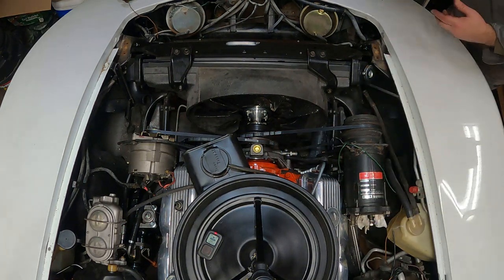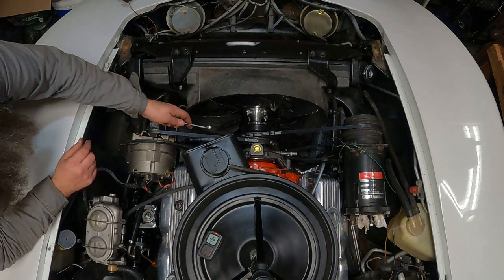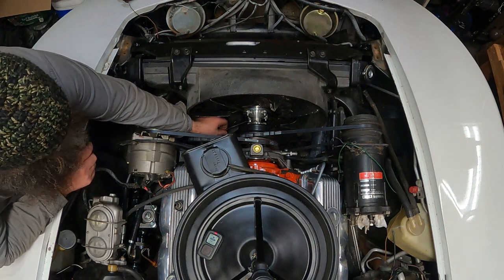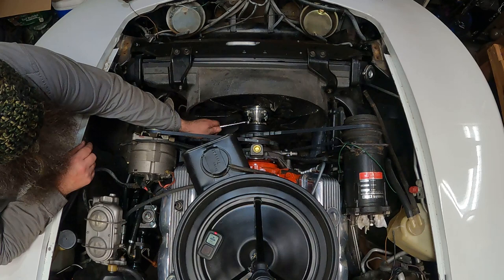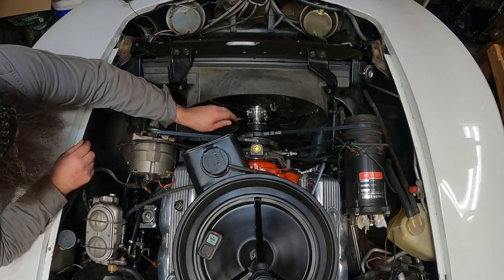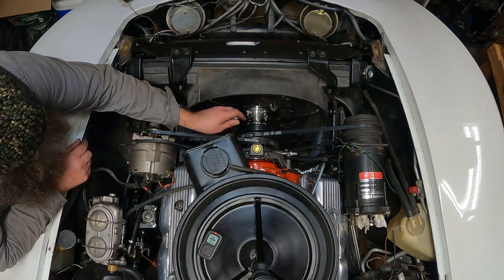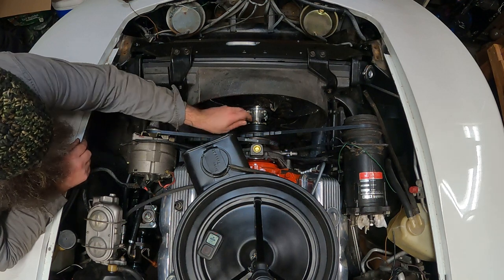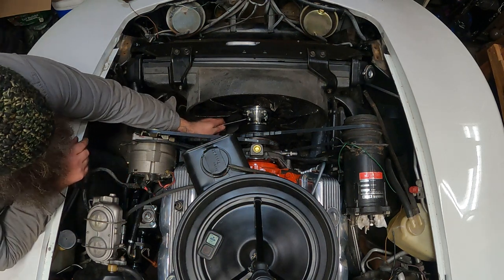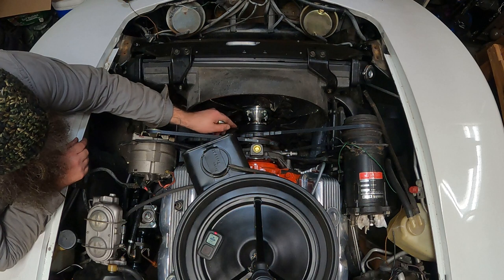And since my vehicle was already equipped with power steering, I didn't have to get the power steering pump. It's a decent system. I did have to push the steering column extension back a little bit to fit the rag joint. But other than that, the hoses that they provide lined up. Yeah, so it's a pretty nice system. I'm dealing with hooking up the power steering hoses now, and whatnot.